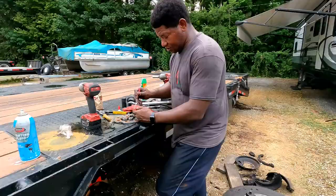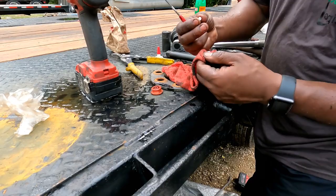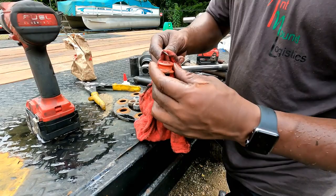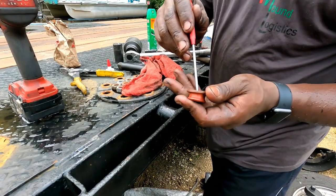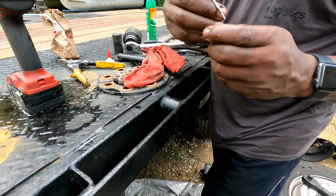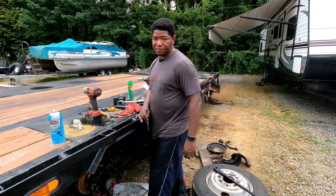I'm going to show you guys the vacuum cap — there's a magnet in here. All you've got to do is take it out and clean it. If you had something in there, you could just clean it out like that. Stick the magnet back in. Very important: you want to ensure this hole is open, or you're going to blow your axle seals. Whether you have plain rubber ones or a plastic cap, you need to always ensure that hole remains open. If it does not remain open, it's going to blow your wheel seal.